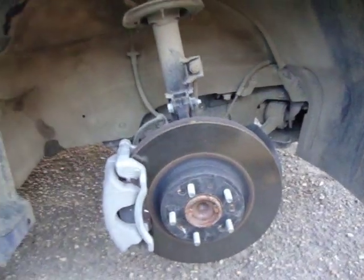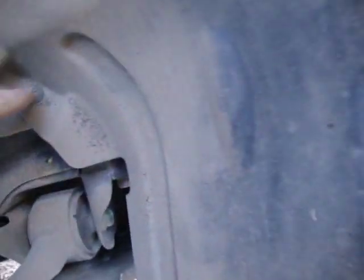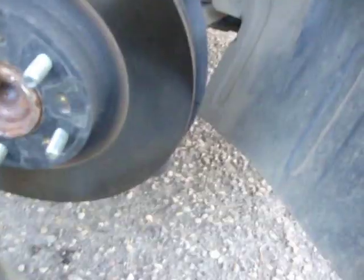But what you're looking at when you got it all out, what you have to do is take out this bolt here, this plastic screw here, this plastic screw over here, this retainer clip up here, this screw down here, and you've got two retainer screws along the bottom. And once you get those out, we can continue.